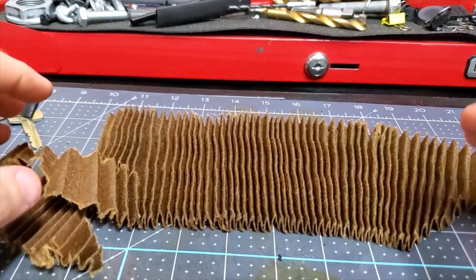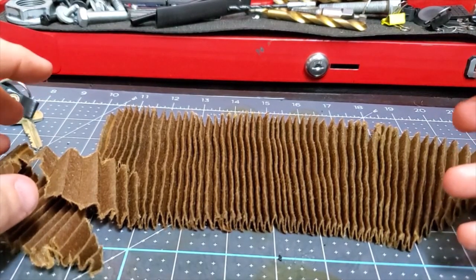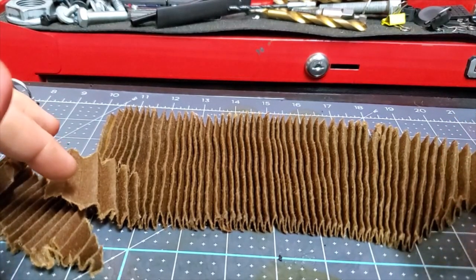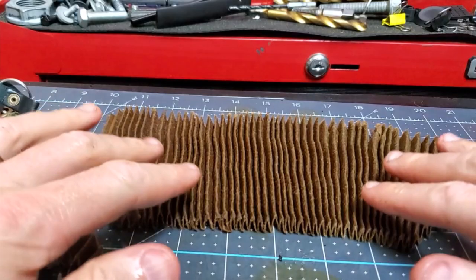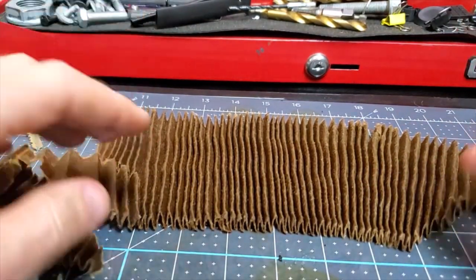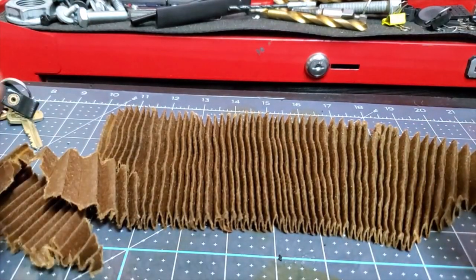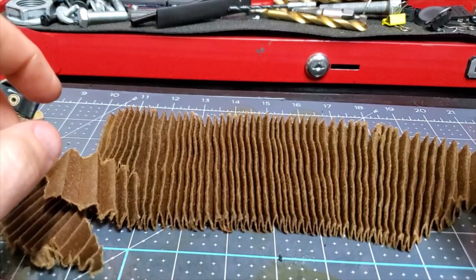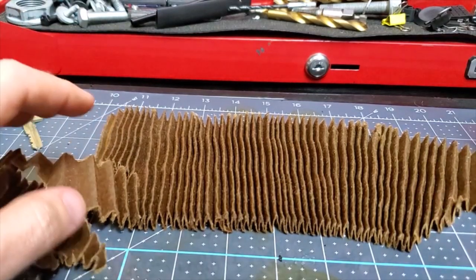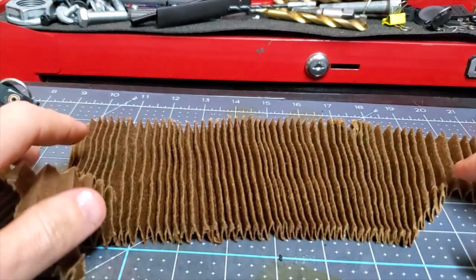The engine is going to have some type of material. There's machining of the head, there's machining of the block — it's aluminum — so there's going to be leftover millings. What your initial oil change will do is flush all of that junk out of there, stick it in the media, stick it in this filter. In your first oil change — first thousand, two thousand, whatever it is you decide or the dealer decides — the first 3,000 miles.